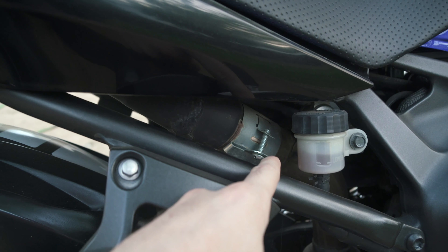Also, something you'll probably be wondering if you're actually considering building this yourself: the stock pipe back here that goes all the way up and back to the muffler has a bend in it, whereas this one does not. You actually don't need to bend any pipe. I've heard some people saying that you need to bend the pipe just like the stock one — you do not. I know this from experience. This pipe here has no bend in it whatsoever. It just has that coupler down there that fits it into the stock pipe. The coupler I welded onto the three-inch pipe — I just cut an angle off of it so when you put it in, it fits onto the mid pipe, which is kind of at an angle going back into the engine bay. But again, this pipe is perfectly straight with no bends whatsoever.